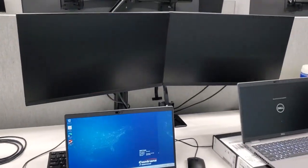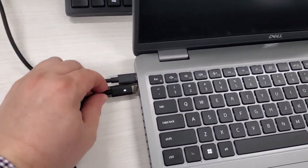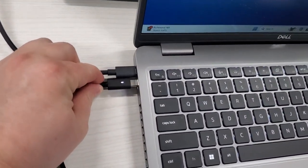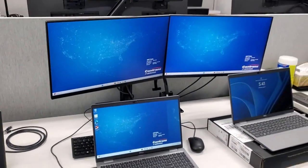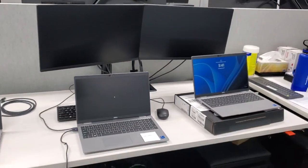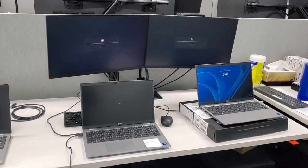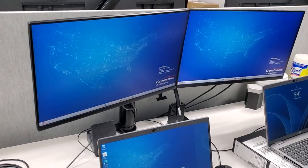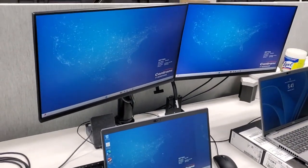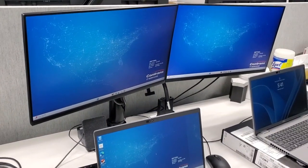We've done this with about 5 different 5540s and shown it. When you're above 20%, and now under 20%, it seems to still flicker when you're plugged in with the charger. But if we have both the charger and the docking station hooked up, the docking station, we have found, will stabilize as long as you're above 20% battery on your laptop.